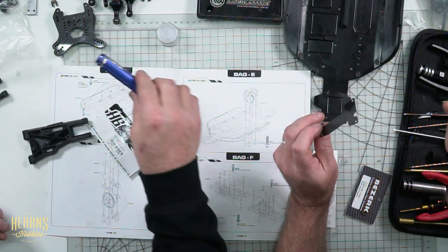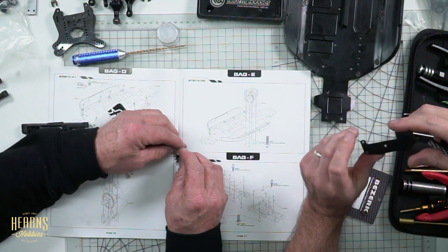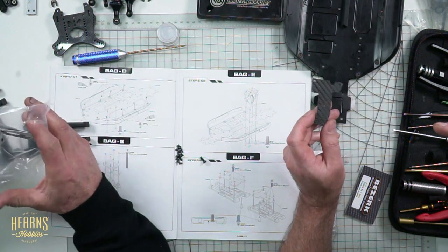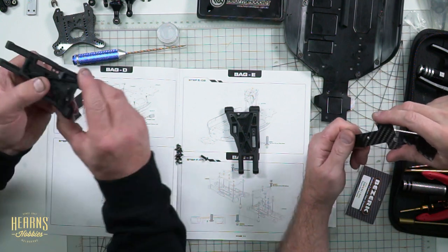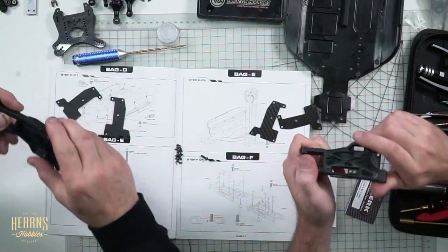But my front drive shafts will remain straight. Now, if I put the standard arms on and I cartwheel it, there's a good chance that every run it's going to come back with buckled drive shafts on the front. When you say buckled, you mean bent, like a bow in them? Yeah, a bow in them. And I do not like that at all, because there's a lot of flex in the arm. And when you're saying flex, are you talking about twisting across? Twist, too much twist. So that's why you've gone hard arms. Yeah, so this way they'll just shear off.